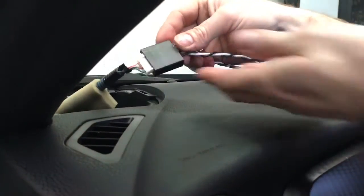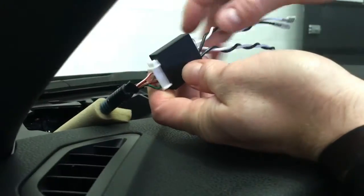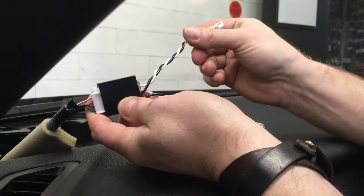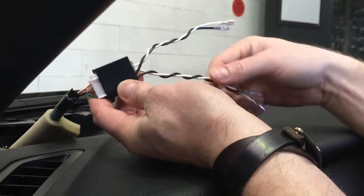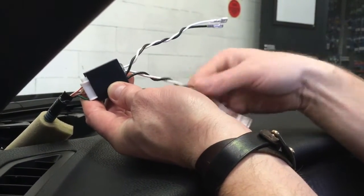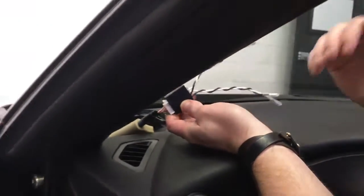You don't need to cut it. And so the top wires closer to the clip, or the releasing latch, the top ones are out of your stereo. So they will actually go into your crossover, all right? And then these bottom ones go out to your woofer. So use the woofer out to those bottom ones. So white will be positive, black will be negative, all right? And that is as simple as that, man.